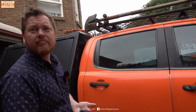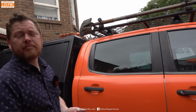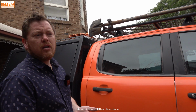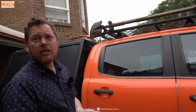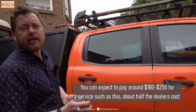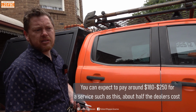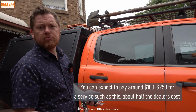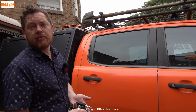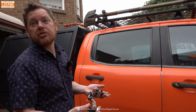It's probably a good idea to do this before you actually lose a key, right? Because if you've lost a key completely, let's say that you lose all the keys to a car, then you are in deep trouble, aren't you? Not deep trouble, it just costs a lot more. Generally, you're having to obtain key codes from the vehicle's VIN number, and a lot of locksmiths will need special subscriptions to access that information, and automatic code cutting machines to remake that key because you don't have one to copy.